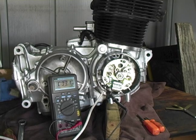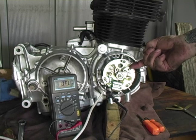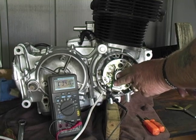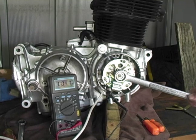I just moved the positive meter lead to the yellow wire — that's this one here — for the 2-3 cylinders. We're going to make sure that when it opens, we read it. Yeah, we do. So that's fine, and then it's just the same thing we did on the 1-4. Just going to rotate it very slowly as we get up to the F mark, as you watch that meter.